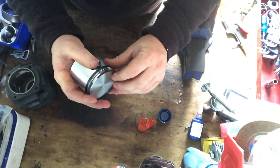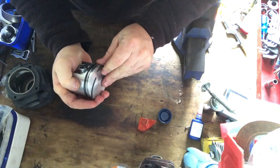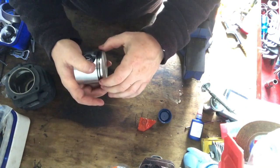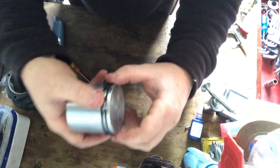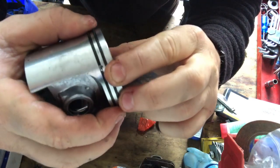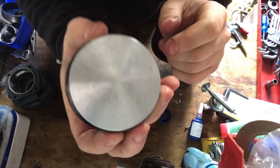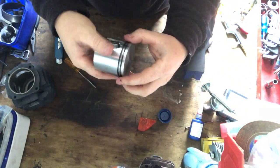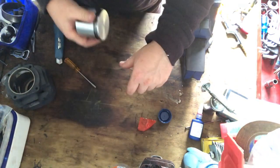So I'll just slide this last ring over now. That oil definitely does help slide it all over. So now those bits there, they all line up with that pin, squeeze in like that. And this is all on the intake side. Remember I was telling you before in the other video — if you look, you can see the arrow. Arrow means exhaust port. So that part is done now. That cylinder — sorry, piston — is set up ready to go.